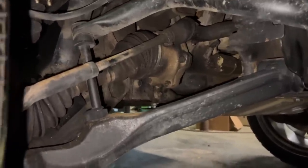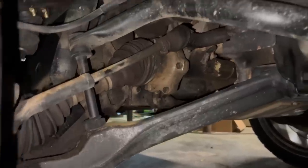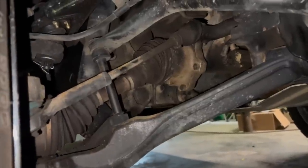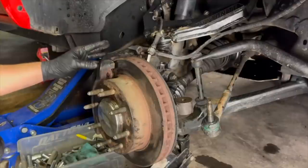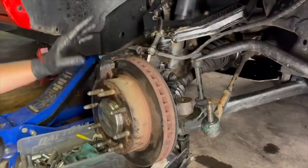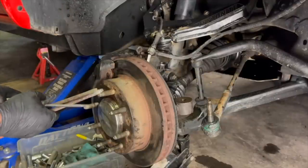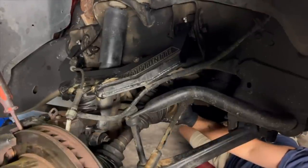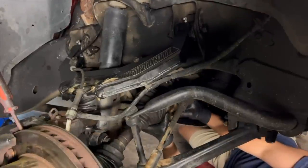That's what it looks like to me, which is probably worst case scenario. I was thinking maybe the axle popped out when we put the upper control arms in, which is possible. I'm 99.9% positive it's not the brakes or the hub, so it's either the axle or the diff. So we're going to go ahead and pull the axle — all I want is the diff to spin free. Please and thank you.